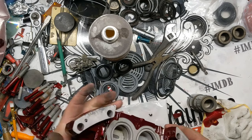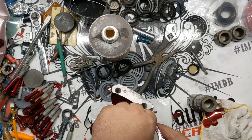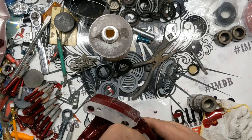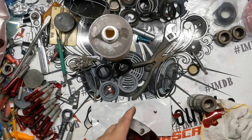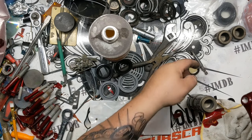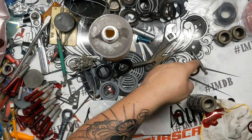Smash it all down. Put the smaller one in as well. You can drop both the pistons in at the same time. Once again, make sure you're grabbing halves that match each other. You want the bleeder holes to both be on the same side when you put them together, because doing all this, then taking it apart to fix it would suck. Be a bummer. Some lube, or at least some brake fluid on these.